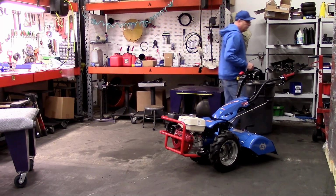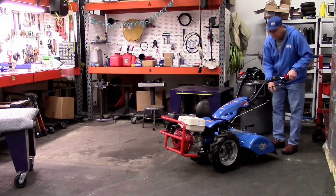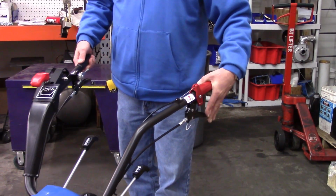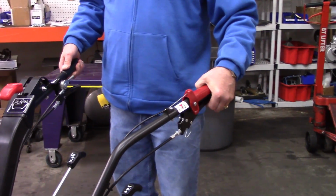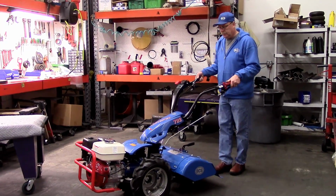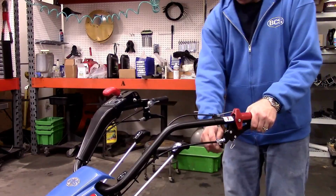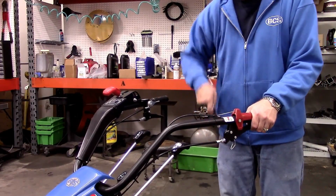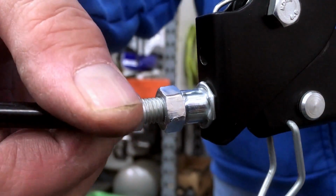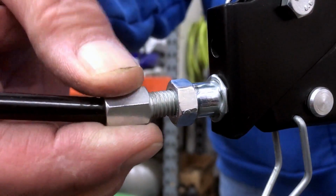Start your engine, shift into first gear, and test to see if squeezing the clutch completely brings the tractor to a stop. If so, tighten the jam nut against the bracket and you're finished. If not, repeat the process by turning the tube counterclockwise till 3 more thread wraps are visible, and test again.